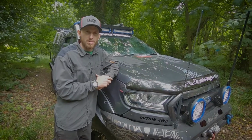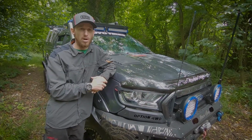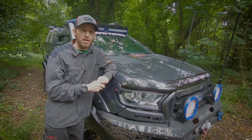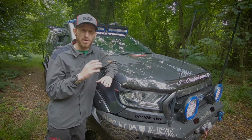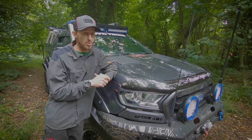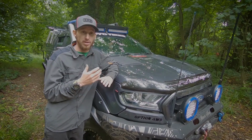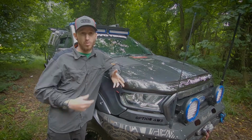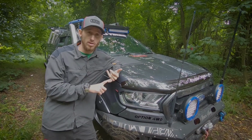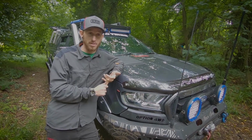So you have it, guys. Very simple install when it comes to the dual light bars. All you're doing is just doubling up on your wires, but the most important thing I can't reiterate to you guys enough is making sure that your cables and your splicing, however which way you do it, is done correctly, and you take the time and do it the best way you can, or get a professional to do it, making sure that the cables are properly soldered together and they're waterproofed and they're protected.